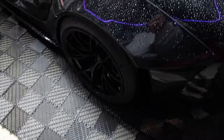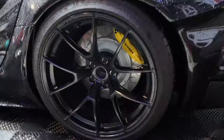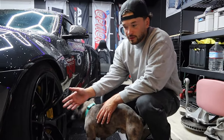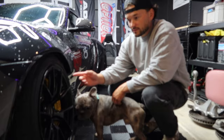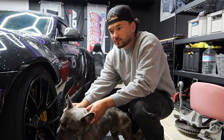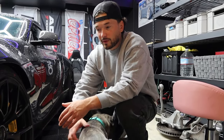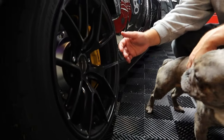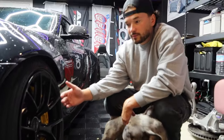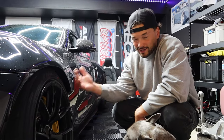I really like these wheels because from the outside you can't even see the brakes — there's a ton of concave, and I love concave wheels. But when you get down low, you can see the Brembos in there. At the front it's the same VS5 RS wheel, but this one is not for an A90 — it's actually for an E90. The reason is when you convert WiseFab on these A90 Supras, it requires you to change to an E90 M3 front, going from 5x112 to 5x120. So if you want to run a big brake kit with WiseFab, you have to run a big brake kit for an E90 M3. The wheel is a lot less aggressive — it's an 18x9, plus 30 offset. When you run WiseFab kits it acts as a drop knuckle, and the lower control arm pushes the wheel out about two and a half inches, and you're also seeing about negative seven degrees of camber.